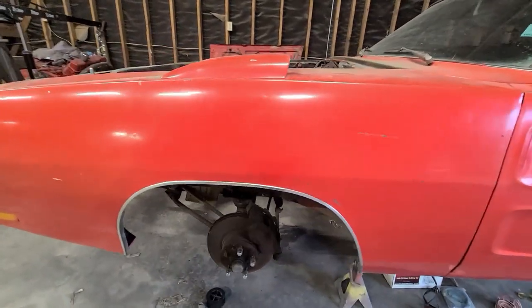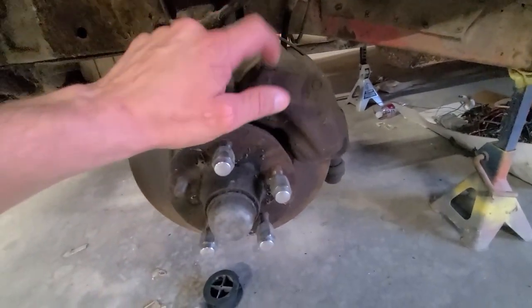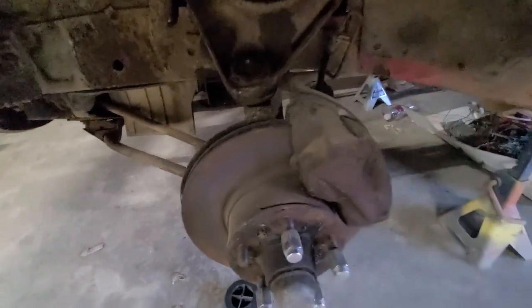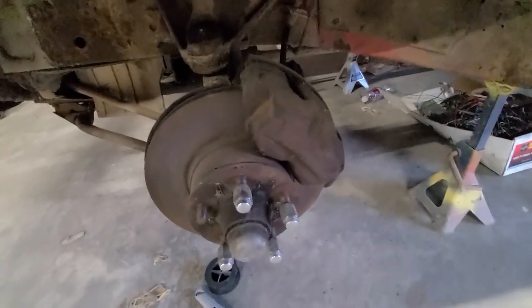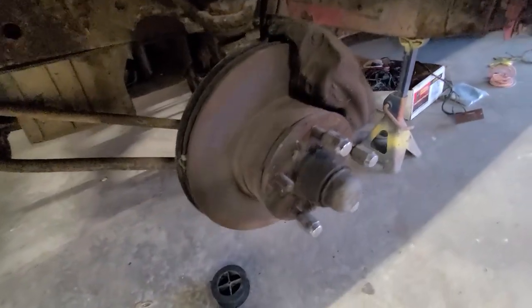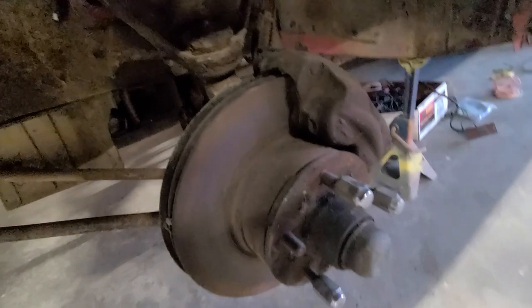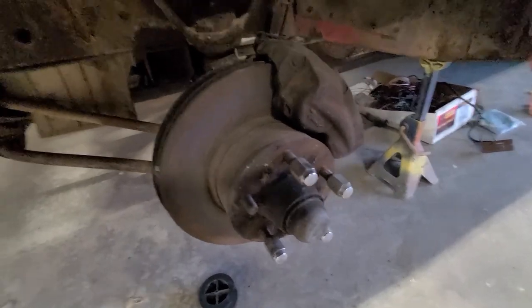Take a look at this. You've got the scoops here, and the original brakes. This is what would come on a 1969 — they changed it in 1970, they went to a different braking system, different calipers. A lot of these things were used on 440s and Hemi cars. This car, of course, was a 440 car, so it would have come with these. Look at these right here — the rotors, two-piece rotors. That's the way they came. It's not somebody who came in and replaced them with one-piece. Those are the original two-piece. It's all here. Very nice car.